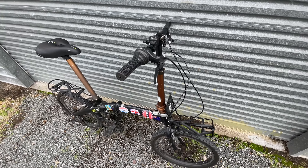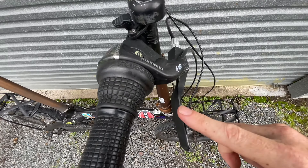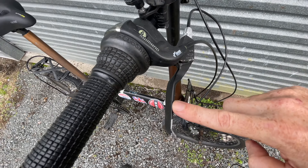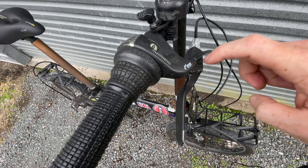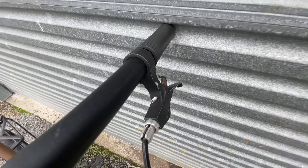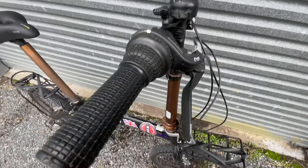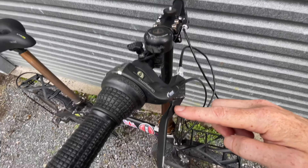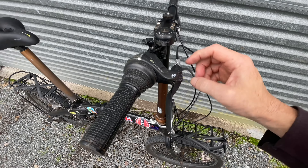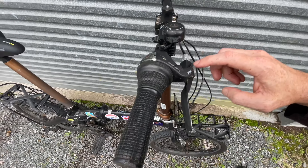I positioned that bracket just below the handlebar so as not to interfere with the folding mechanism — the folding mechanism still works perfectly even with the front carrier on there. As far as the controls go, I don't think I replaced anything on this bike, but previously I've made upgrades to the brake levers. If you buy a particularly cheap folding bike you'll find these levers are plastic. I do like to replace them with cast aluminium brake levers — they're just a bit stronger. On my first folding bike tour in Japan I had a plastic lever that fractured from riding down so many hills with a lot of weight on the bike.